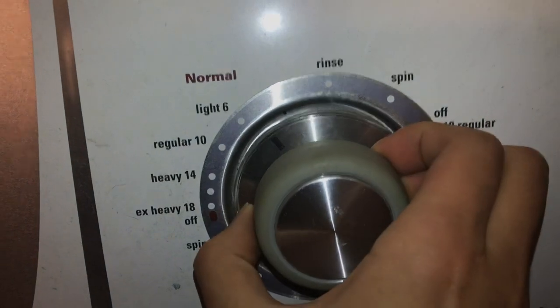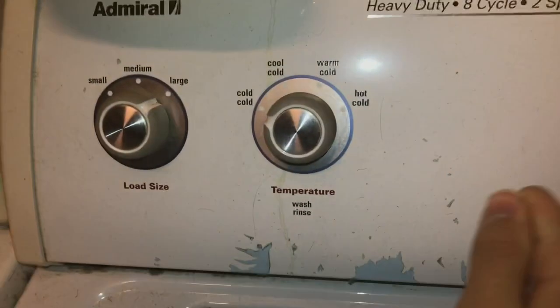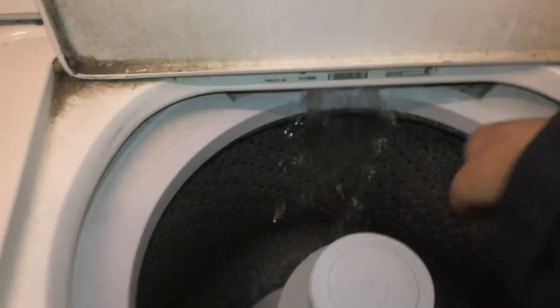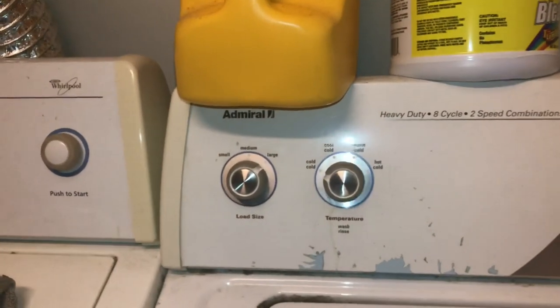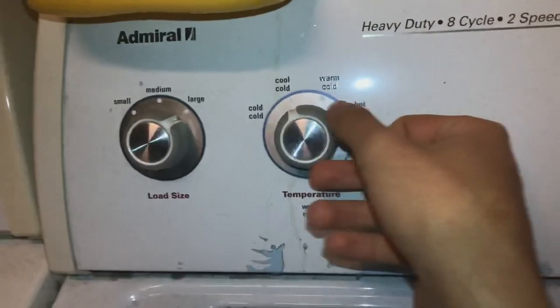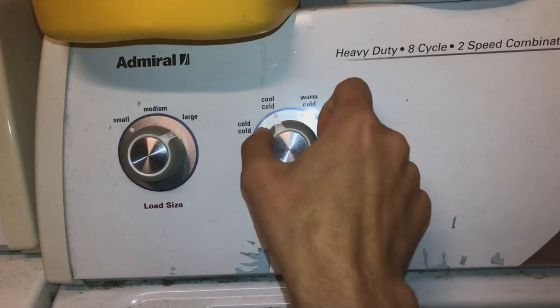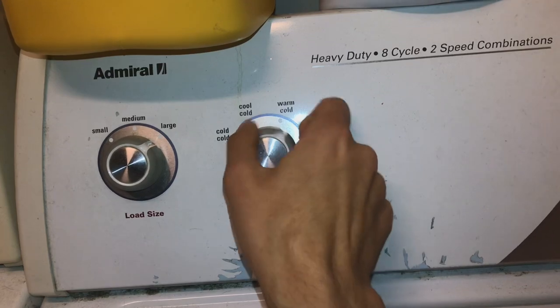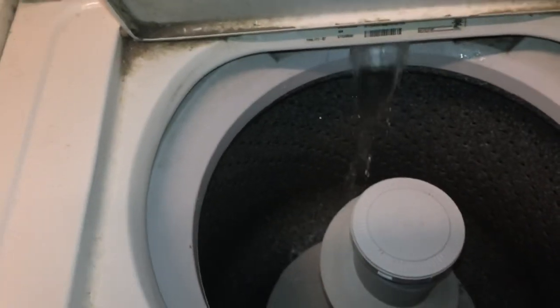Let's first test the water fill with a pulse start. Starting the cold water right here — it's maybe a little cloggy. Now cool water. The humming noise is just how it works as it pumps water to fill the tub. Warm/cold now — I believe the cold valve is on and the hot valve might be a bit clogged.